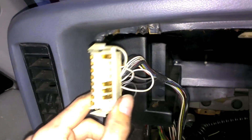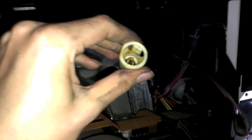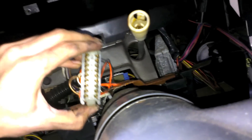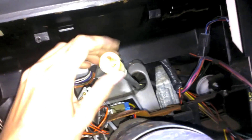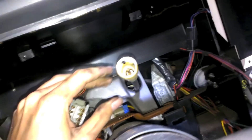On the back you have this connector right here — this one does your lights, sits about there. This one does your gauges and all that, sits about here. Then you have your speedometer cable which sits about there. This one's got a clip — you squeeze the clip and wiggle it out. Make sure to check whether yours is a clip or something else. To get the connectors out, you push down on the little tabs and pull.